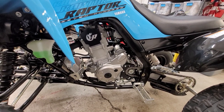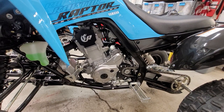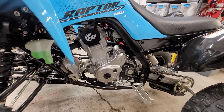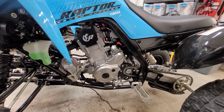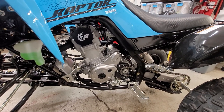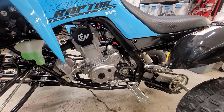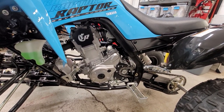Basically all of the upgrades we can do to make these things make the best power as possible, but live as long as possible and push RPM. So all of our head setups can run safely 9600 RPM. That is a big change off of what anybody else is doing. So in this camshaft profile, we run it low 9000s. Pretty much on the factory limiter is fine. We can bump it a little bit. On our plus two heads, we can change that. So if you're interested in that, give me a call.